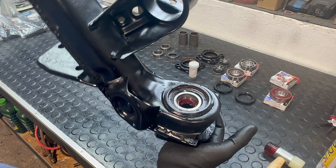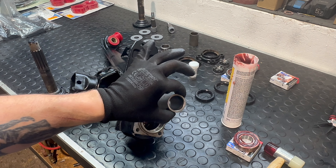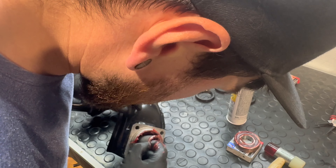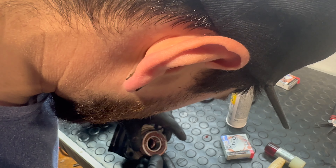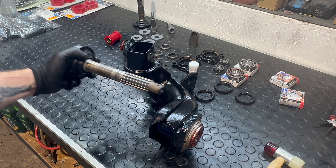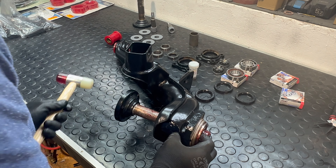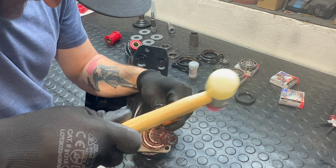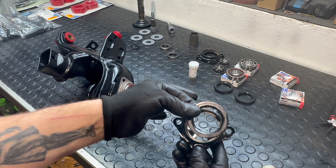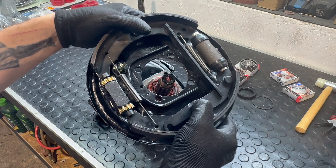That was easy. This side is almost done. Now let's do the other one — first of all we need to put a lot of grease in there, then we will put that biggest spacer in there and then mount the bearing. Now the axle — we have to push it in all the way through. It's in — a few minutes of hammering and the job is done. Now I will put that seal into that cover, and the next step will be connecting these two together.